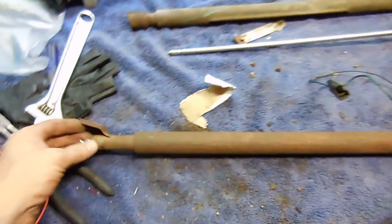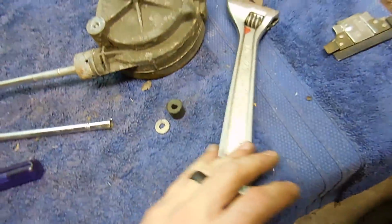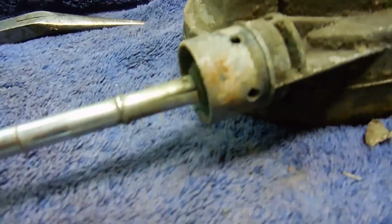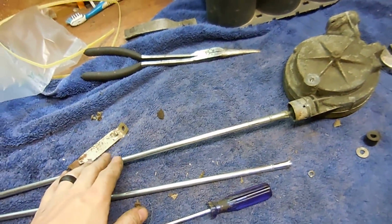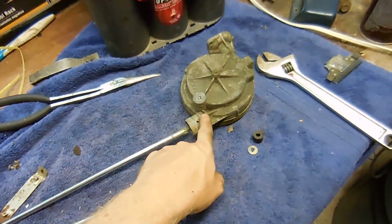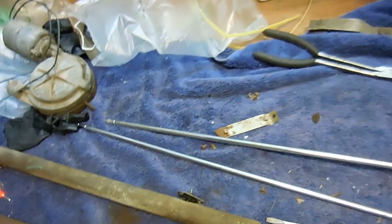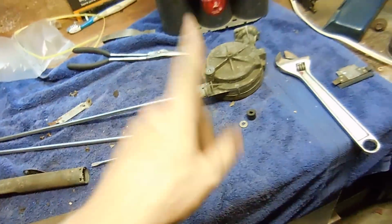So I think I have to go and get this antenna out of this shaft and then put that one in it. If you look at the very edge of this antenna, this is from my 56. This is what I pulled out of it. Basically, this is the ring that attaches the nylon cord that's inside of it. And if you look here at the 57 or 58 antenna, you can see how it's still attached. So the plan is, I'm going to swap my longer antenna mast onto here, and then I'm also going to put the 56 part onto the 58 part, and then fingers crossed, with a good motor, and I know all the cords and everything in here is good, it will lift my mast in this, and we should be good to go. All I did was swap the top ends. The mounting point will be the same, the antenna will be the same, the point where it goes on the fender will be the same, just the bottom end will be different.